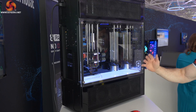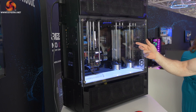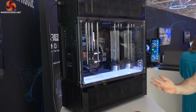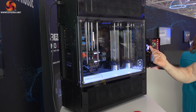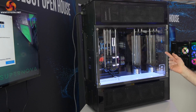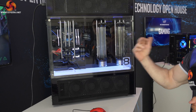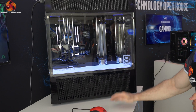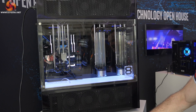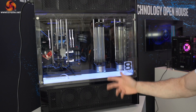So it's a limited edition run. We've got that 14-core, 28-thread, 5 GHz boost frequency CPU, and we've actually overclocked the all-core frequency to between 4.7 and 4.8 GHz. You've got two 2080 Ti's configured in SLI. In this demo unit it's 64GB of memory, but the customer configuration is 128GB standard. You've got 4 terabytes of NVMe storage and 10 terabytes of HDD storage, and a 1600W PSU.